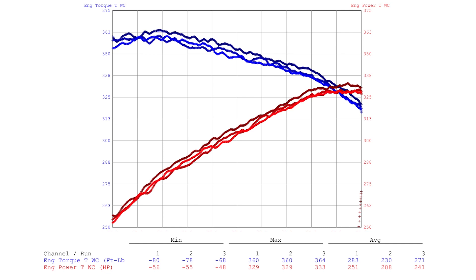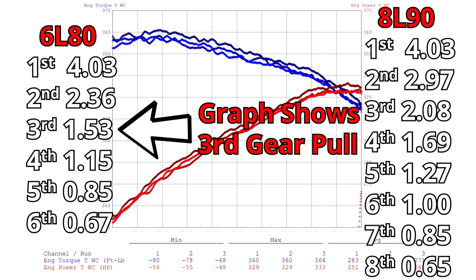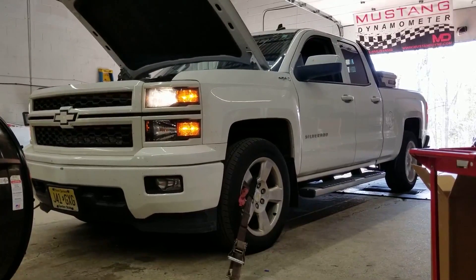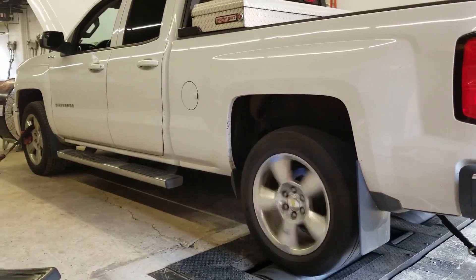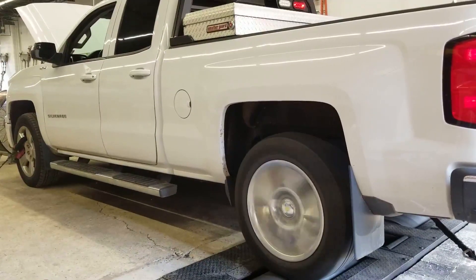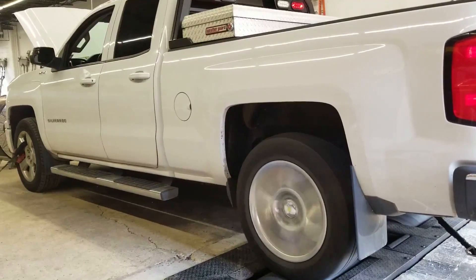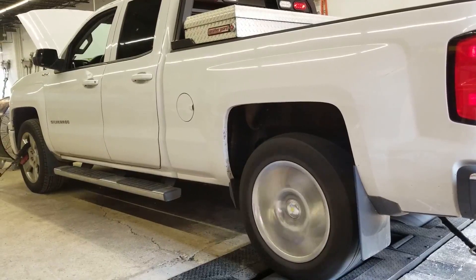The tuner told me that the truck would not hold fourth gear, which is the closest to the one-to-one ratio — I believe it's a 1.15 ratio in fourth gear. Because of that, he did a run from first through third gear, and the graph we're overlaying right now is from 65 miles an hour to 95 miles an hour. I've been trying to get an RPM graph as well as the full mile-per-hour graph from zero to 95. By the time this video comes out I may have those — if not, we'll either do a subsequent video or have links in the description where you can see those dyno graphs.